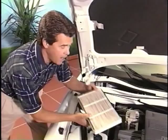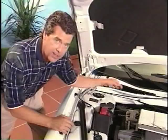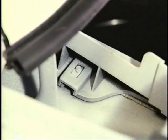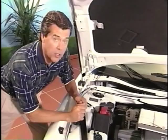A leak which occurred on an early car was at the housing that holds the air filter in the cowl. In the plant, this part is referred to as the stovepipe. The leak is caused by an incorrect fit of the housing for the HVAC air filter. If the air filter housing does not fit flush over the studs, the expandable seal material here will not fill the space, and water will run under this plastic piece, around the blower motor, and eventually into the front carpet. The blower motor may also short out.